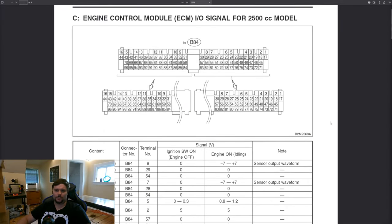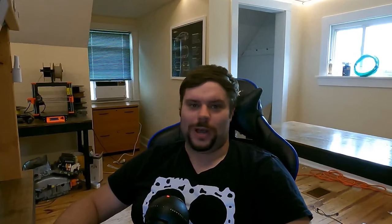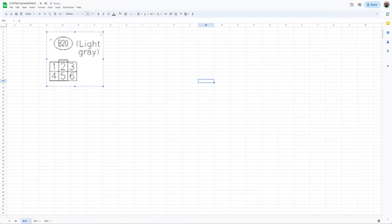If you're missing connectors, just go to the junkyard and snip them off one of their cars. You might be thinking going through those bulkhead connectors seems pretty complicated — you'd probably rather go right from the Haltech to the engine instead. And yeah, that's fair. But remember, that bulkhead connector has just about everything you need, especially switched power for your injectors, ignition coils, and solenoids. I'm gonna show you a little trick to make things much easier. Remember the handy pinout we had for the Subaru ECU connector? Wouldn't it be nice if there were pinouts for those bulkhead connectors as well? Unfortunately Subaru doesn't provide any, but it's really not that hard to make your own. It looks like there are three bulkhead connectors: B20, B21, and B22. So I'm gonna make a new spreadsheet with three pages — one for each connector — and put a little screenshot of the connector on each page.